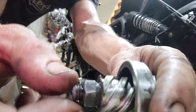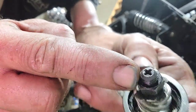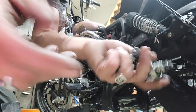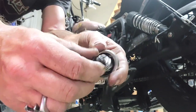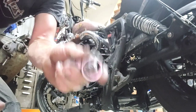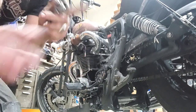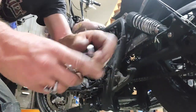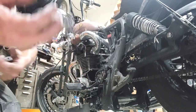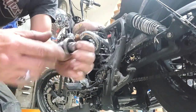Now the extra one does not have the adjuster screw. If you see in the original one, there is a nut right here, and this rod — a Phillips, actually it's probably JIS, but whatever, same difference — you loosen the nut and this adjusts your preload pressure onto your clutch, takes most of the slack out, and then you do fine point adjustments on the clutch cable up by your handlebar. We're going to set that aside because we don't need it.